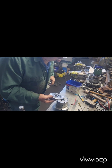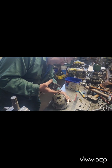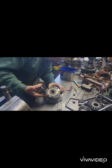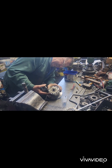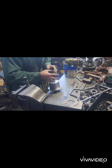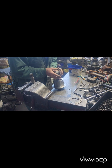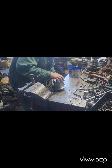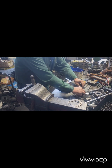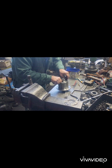So all I've got to do is put this thing together, find out where I am, and it'll be right. Here it is there. It's turned between centres, this thing. Would you mark it to go only one way? Chisel marks. Like put it around 180 degrees different, will it run out of true? Well, there's a possibility that could happen. They're relatively concentric, these things.